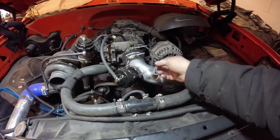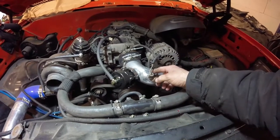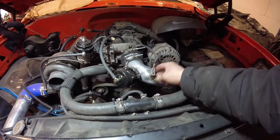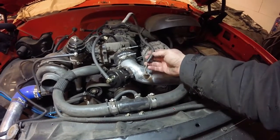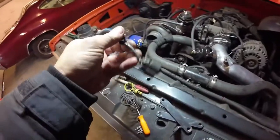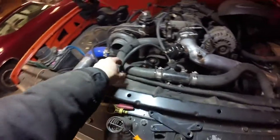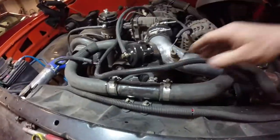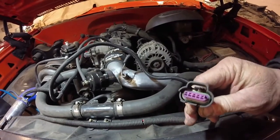So that's a pretty good one — it doesn't always work out that way, especially if you had to buy the pigtail with an aftermarket sensor. But this is actually out of a GM vehicle, so it should be fine. What we do right now is we'll take the wire here and we'll cut the wires off. We'll probably trim back what we don't need, because we don't need all of that. We'll cut most of the thing off, pull that back, and we'll join some wires up.